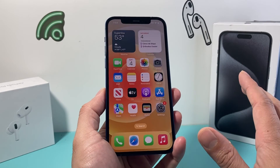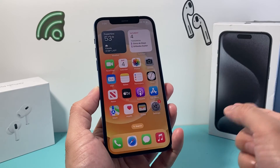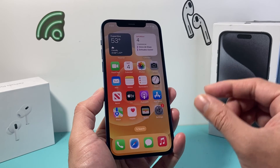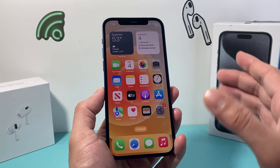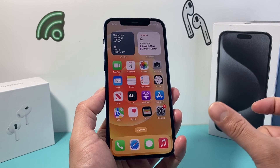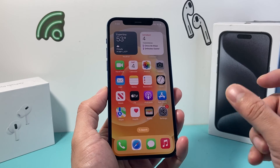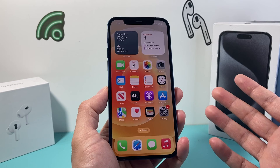Now after doing all of this and you're still having the issue, do consider getting a new SIM card, or test out your old SIM card on your phone if you have an existing one, to verify that works. Because if that works, it means the new SIM isn't working or the account hasn't been activated — so contact your carrier. Another thing to consider is moving to a different location, because sometimes your carrier might have a dead zone or areas where you don't get much signal. That's why you might see no signal or 'searching,' because there's no ability to connect to the tower or network it needs to.